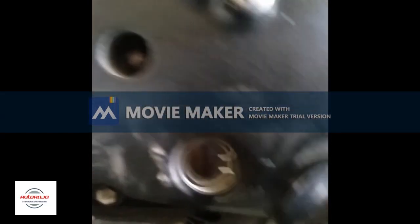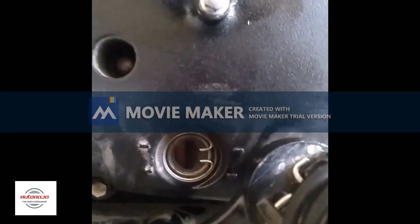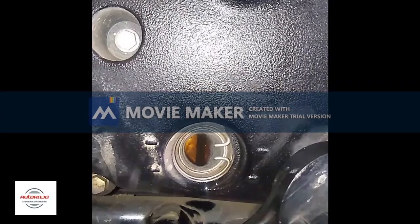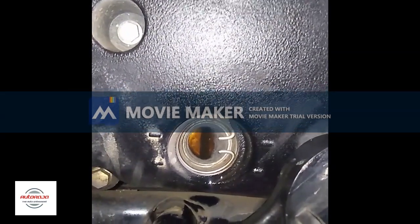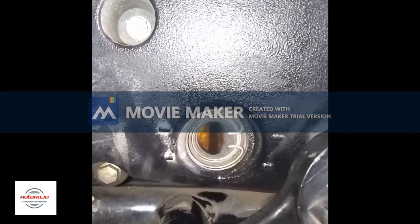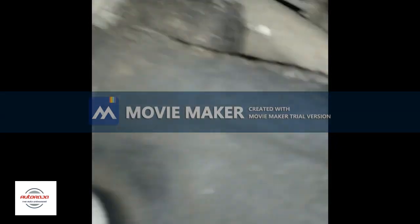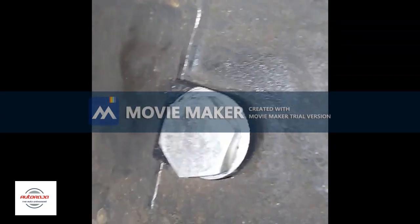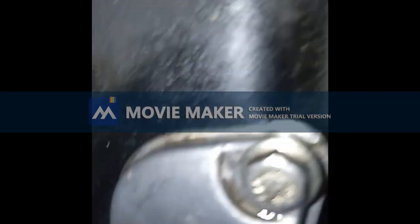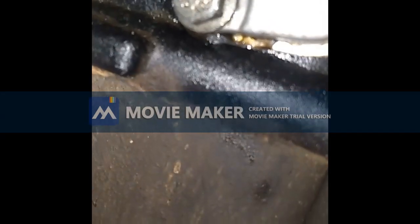And now you can switch off the engine and see what is the level of oil in the oil tank. You can see it is full, and that is how we do engine oil change for Royal Enfield Thunderbird 350X. Make sure that the drain nuts and the filter nuts are not leaking. If it is leaking, you will have to take special care for it.